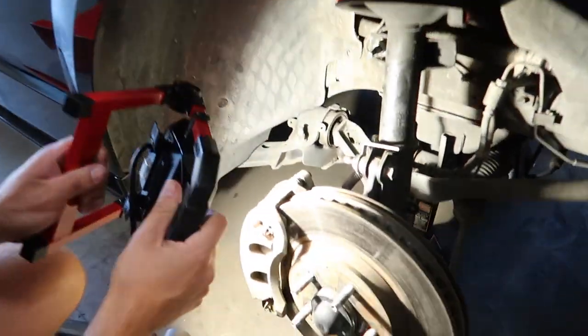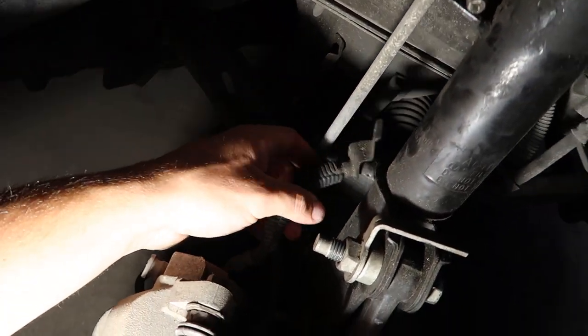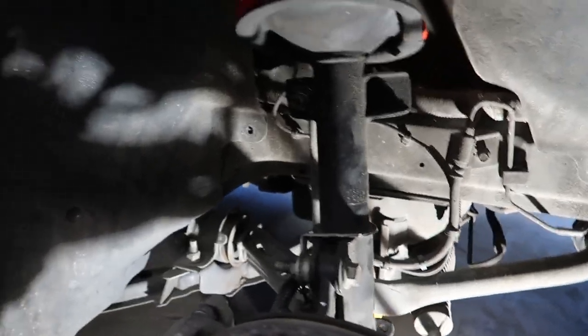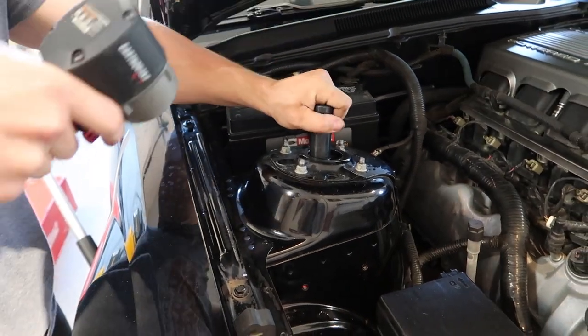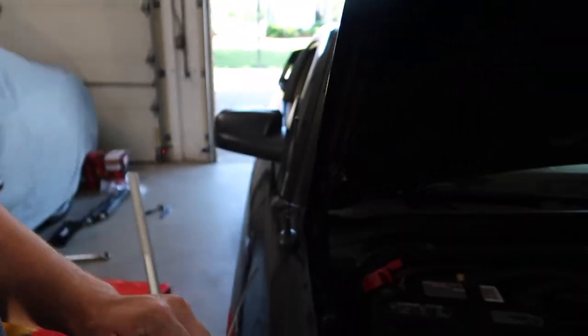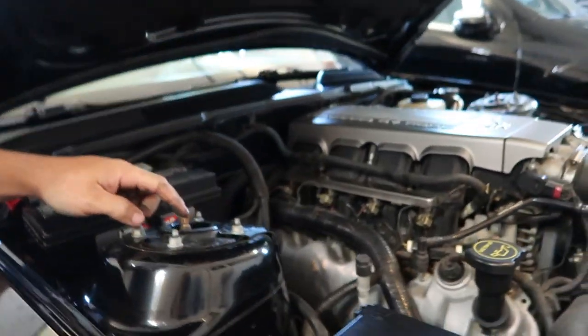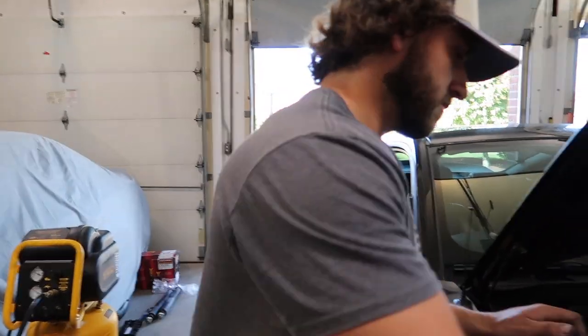After taking a look at the YouTube video again — as if we just didn't do this a couple days ago — we need to take off the little brake line. There's a brake line and another line connected to the back of the strut — we disconnected both of those. Now we're going to do the sway bar end link. Now we're going to take the top bolt off. It was spinning so I had to hold it — came off. We don't have spring pressure so what we're going to do is compress the suspension, take off the upper strut mount, loosen all these up, take it off from the bottom, then slowly lower the strut assembly and it will pop right out.